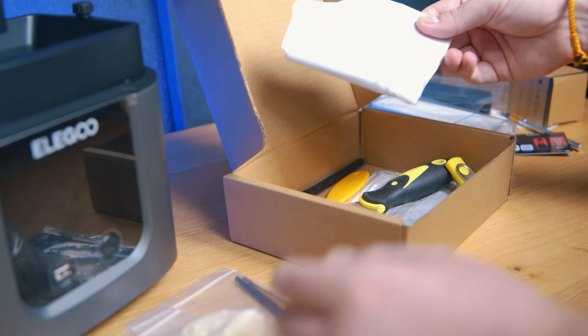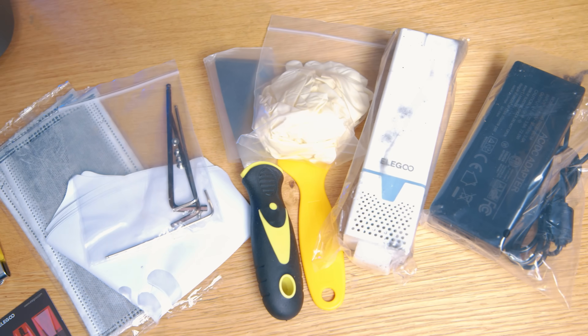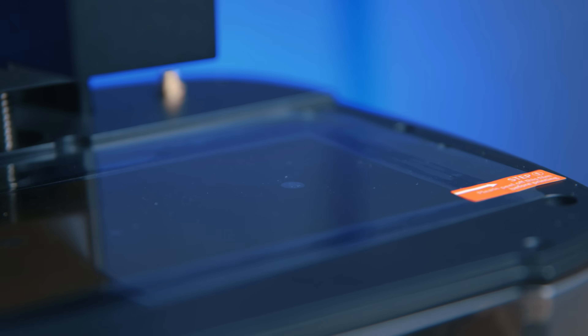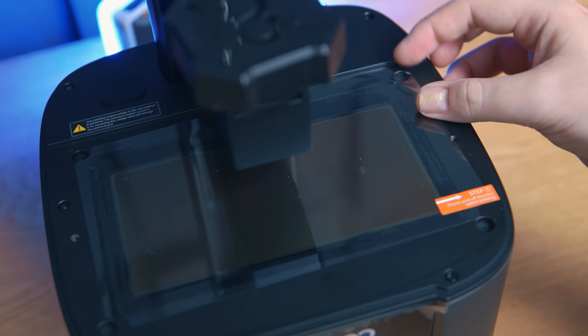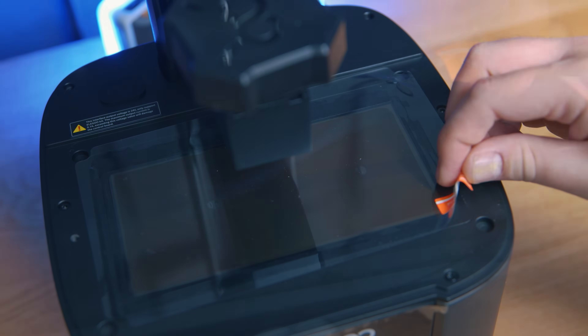I've got plenty to talk about on this printer without spending forever going on about it having dual linear rails, a solid C frame, or talking about all the individual accessories you get with it — you can read all that on the website. The USB drive is rubbish, and if you decide to use this, I recommend replacing it with a decent one from the likes of SanDisk for less than a tenner. And whilst it looks like there's a screen protector, this is just a protective film for shipping — make sure you get one or risk resin spills curing directly on the polariser and you having to replace the whole LCD.